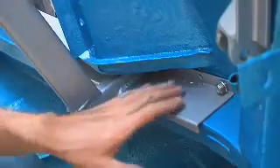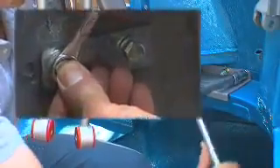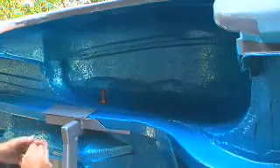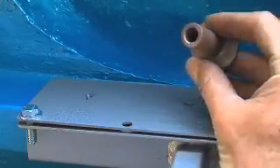Well, almost — some more drilling. Don't you love the sound of steel cutting steel on a Sunday night? I bet the neighbours just love it. Bolt it up to the floor pan in the same way that you fitted the load spreader plate — just make sure all the bolts and nuts are nice and tight. Along this edge there's normally a right angle piece on the mounting plate, but we've had to remove it because the tub job on this Falcon has removed the lip off the chassis rail. We're using crush tubes so that we can bolt through the rail without crushing it.